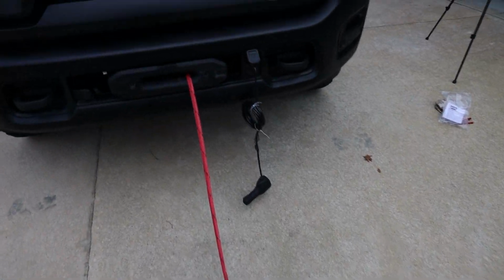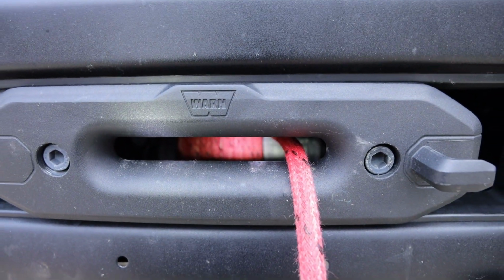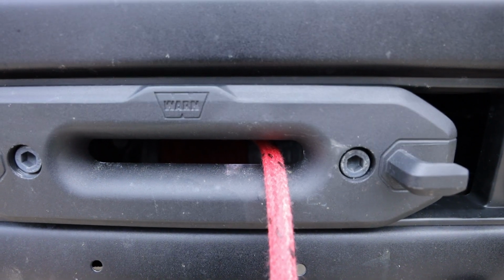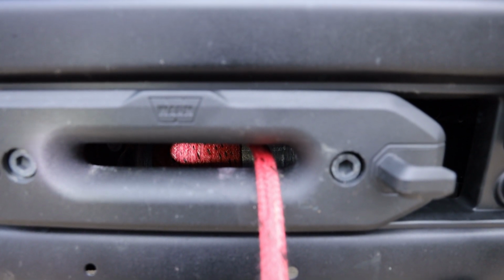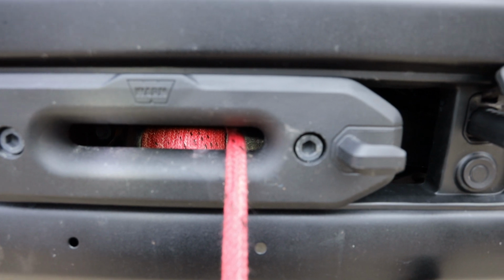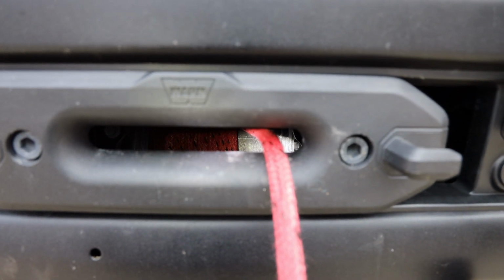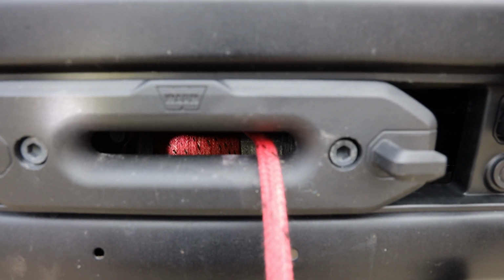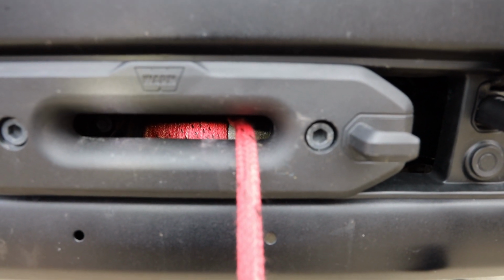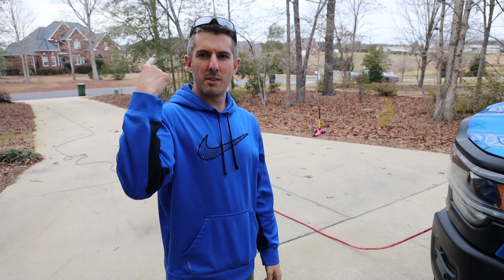All right. Now, looking up here in the winch on the drum. Okay, hopefully it'll focus in there. All right, if you're looking, we got 1, 2, 3, 4, 5, 6. I got 8 wraps still on the drum, okay? And there's the empty part of the drum. You don't want to go any less than about 5. So 8 is a good amount. Let's get that lawnmower to the end of the winch line.